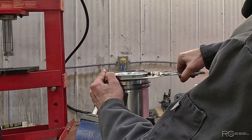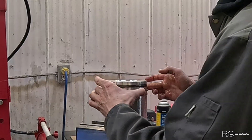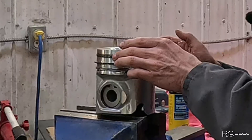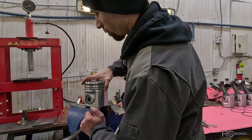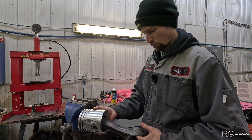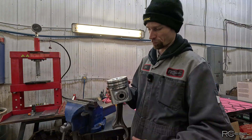And the last ring is going to be our top ring — last ring is the first ring. Same thing: we're going to slide it over top, just to make really sure that we don't scratch that piston up. Now the book says 120 degrees apart, and as usual I will not be aligning any gaps with the pin bores. So we're going to go there, this one's going to go around here, and then this one is going to go over here. Before we actually install it in the engine, we'll do the ring alignment and all that stuff. But right now is a really good time to double-check that we have our rod in the right place — we want the long side on the opposite of the cam and the short side towards the cam. We've got the short side on the cam side, so that's what we want. Perfect.